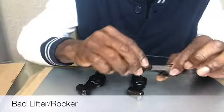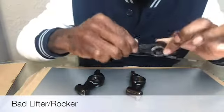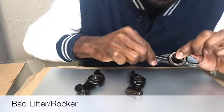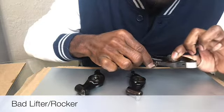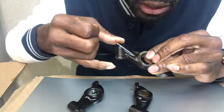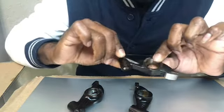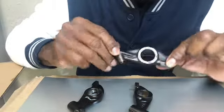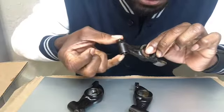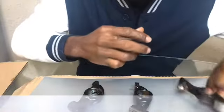So let's look at these lifters. This is a bad lifter — you can already see the spring tension is dead. There's nothing there. The plunger side is not all the way down. I put my nail right here, push it in, and it doesn't come back up by itself. This one is no good. If you have one like this in your car, it's just going to cause a lot of tapping. I tap it and it comes out by itself — that is not supposed to happen.